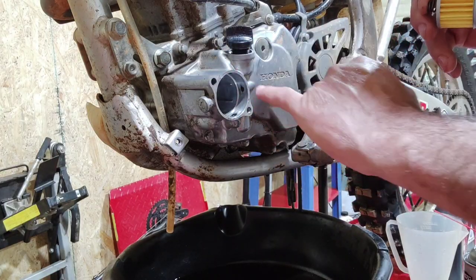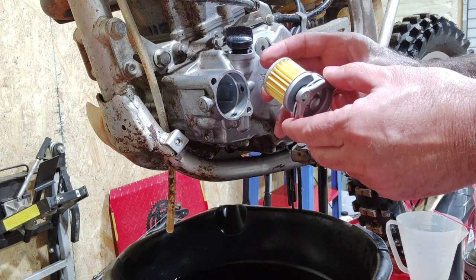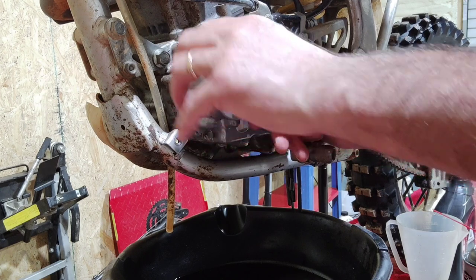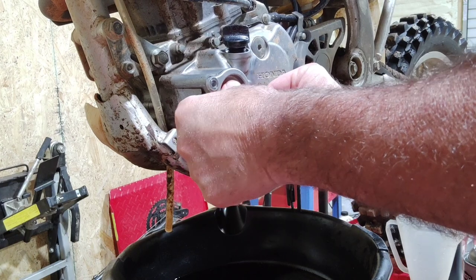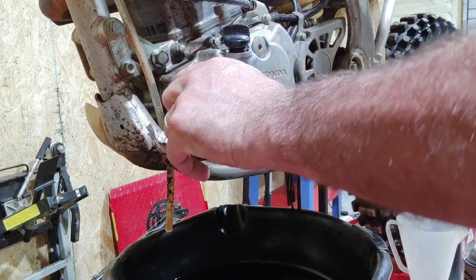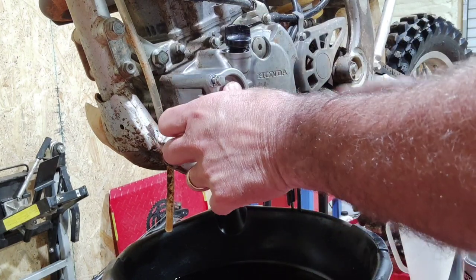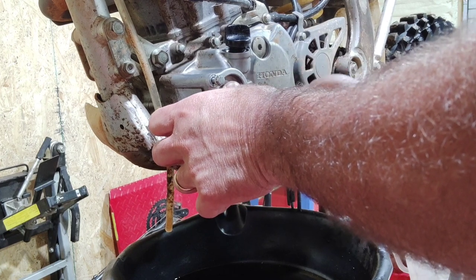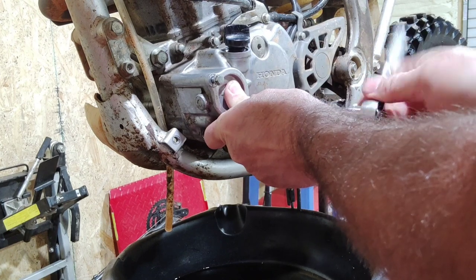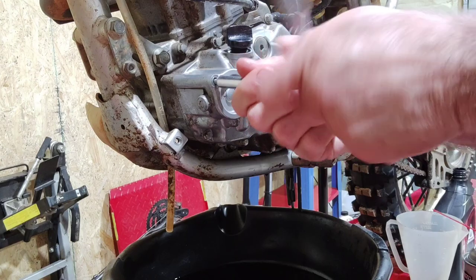There are three holes up in here. One here, one there, one there — these three holes right here. There's another hole right here that just opens up and dumps oil into here. Take it just like this, and then you just want to get to where the O-ring is. Push it in just like that. When you get it in there, hold it so things are not going to move around. Go ahead and spin your bolts back in here. You don't want to come in and out with the O-ring because it doesn't want to damage. These are really low foot-pounds.